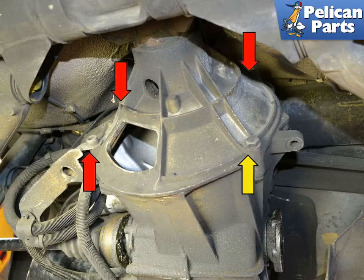There are four places the torque bell housing is attached to the transaxle. Use a 10mm allen for three of them, and one is a 17mm bolt. Loosen these until you are ready to remove the transaxle.